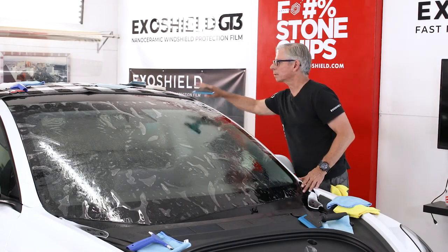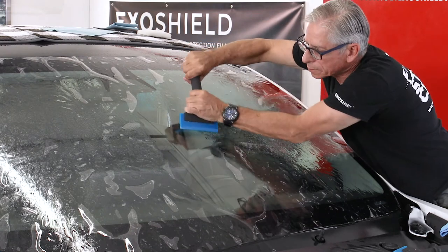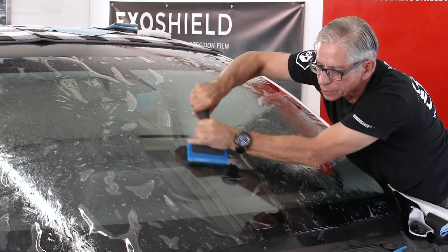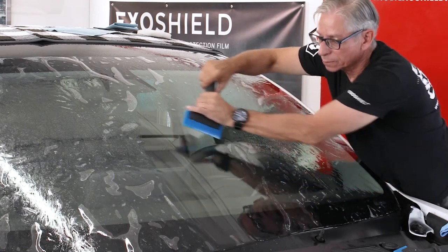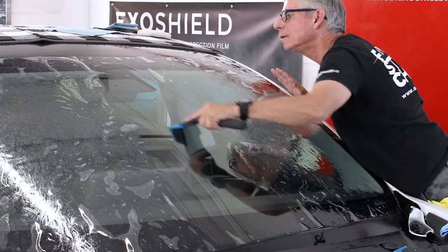The film is laying down with the top edge overhang in place. Overlapping your strokes and applying pressure is key, especially in the center of the windshield, because that's where people most often miss. Start from the middle and squeegee straight down a couple of strokes, then straight up, working to the sides with really overlapping blade strokes. Make sure you're not leaving any water as you squeegee. Take your time — use medium pressure and move slowly, being thorough, until you're at least halfway to the side.